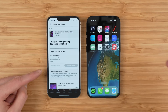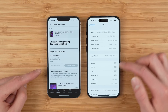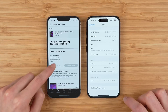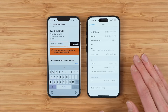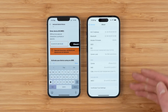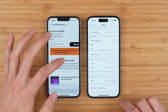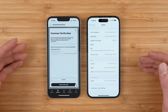Go over to your new device, go to Settings, scroll down, go to General, go to About, and go to SIM 2 — Available SIM, IMEI 2. You're going to copy this IMEI and paste it in. This will make sure you're activating your new phone on eSIM. It's going to be the IMEI 2 — make sure you're using that one. Even if you have a SIM card that's already active, you're still going to grab the IMEI 2 and paste it in. Once that's done, tap check device to make sure it's compatible.